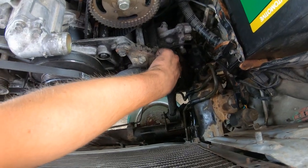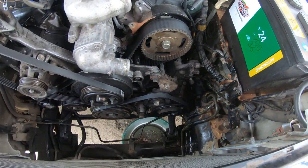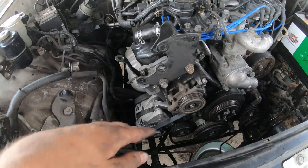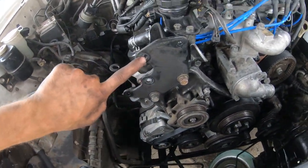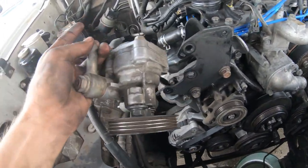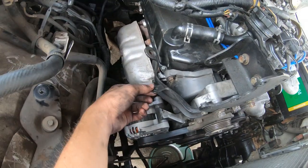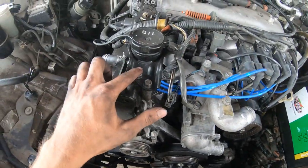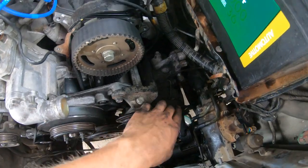I also like to move the AC to the side. I got the power steering pump off and both the power steering belt and the AC belt. To get the power steering pump off, take these two 14mm bolts off, then there's two more 14mms right there, plus a little cover above the belt. You'll also want to take this bracket off and this oil tube off.